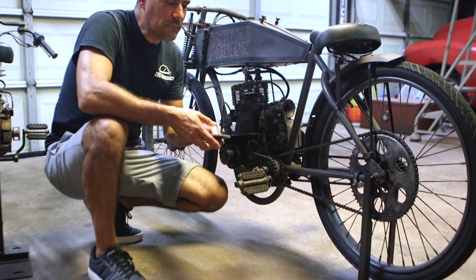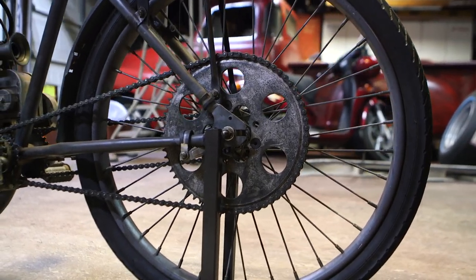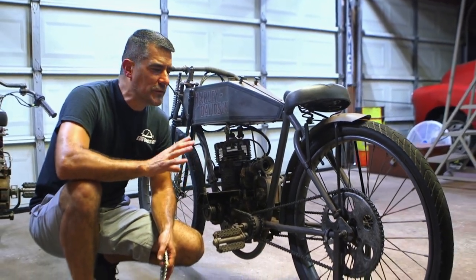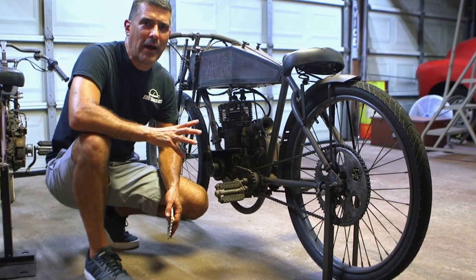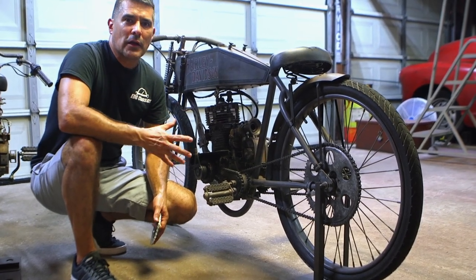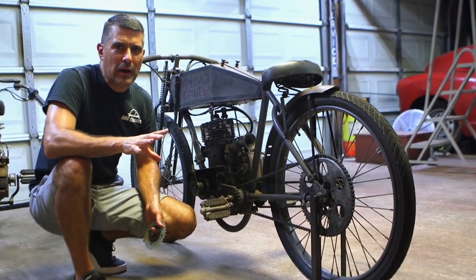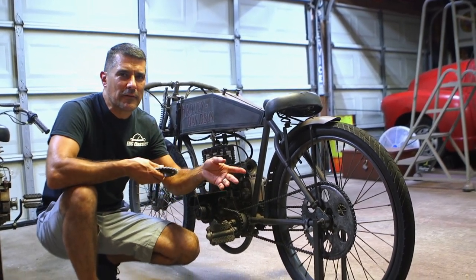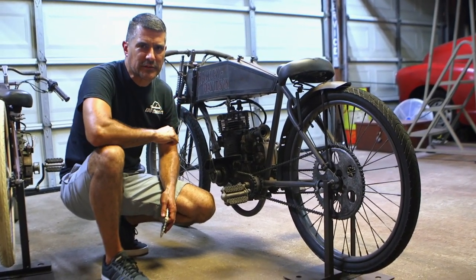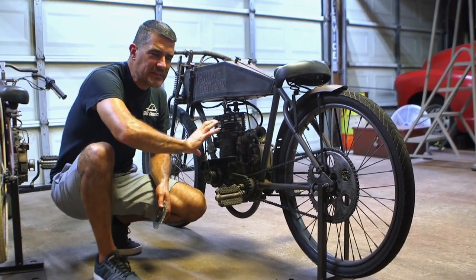This one is a 20 tooth, and we're going to upgrade it to 29 tooth. Then on the back, this one is a 64 tooth — we've also done the 68. A lot of guys will comment saying, 'Oh, you're using such a huge sprocket on the back, you're never gonna pick up any speed.' That is not the case. We ride them somewhere around 25 to 35 miles an hour just cruising around the neighborhood. However, we have run this one and bumped 50 miles an hour with no problem — it gets up to speed very quickly without winding the motor out.